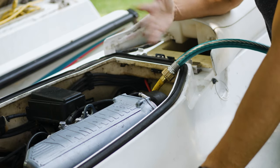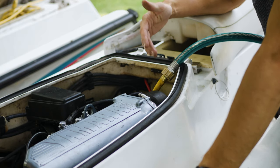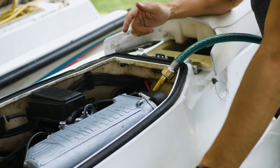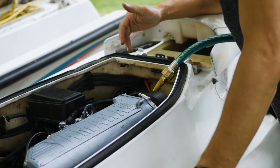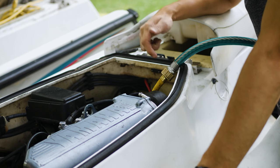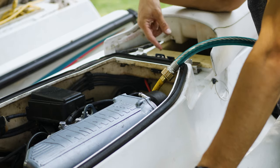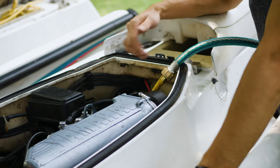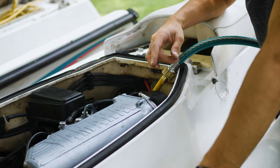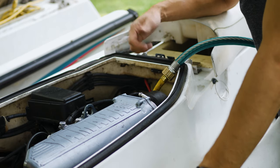Once it's running and you've looked over everything, then you turn the water off and then you shut off the jet ski. We're just gonna run this, turn on the water, look it over, see if there's any actual leak in the exhaust, and then we're gonna make sure we plug in that hose for the coolant and just verify, because testing through this won't necessarily verify that the hose that connects to the jet drive and then to the exhaust manifold is working, but this will at least cool down and show us any leaks in the exhaust while it's out here in my yard. So we're gonna do that real quick and see what we find.